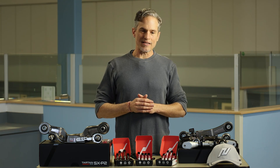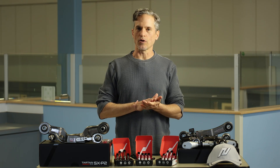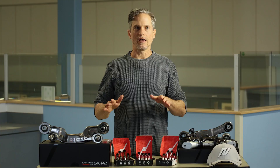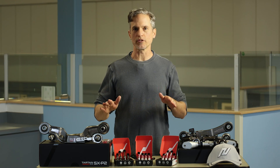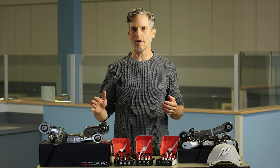With a Tesla, a couple of things: first of all, it's way heavier than basically any other consumer car, and it's got high torque. Furthermore, you've got some adjustability with toe already — not very much, but some. A lot of guys have had their cars aligned where they get the toe in perfect spec and still they've got inner tire wear. It doesn't come in 200 miles, but maybe after 5,000, 7,000, or 10,000 miles they've got really bad inner tire wear, even though the toe is in good spec.